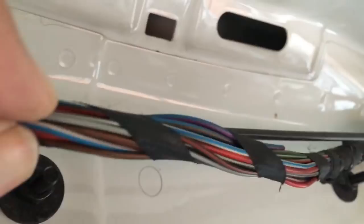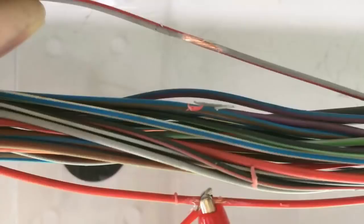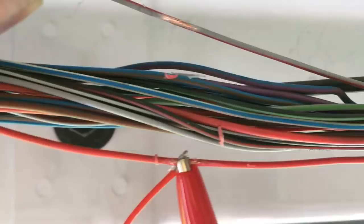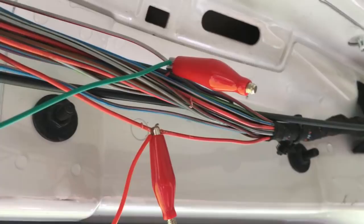I'm going to open up the cable bundle, pare off a little bit of the insulation, and test I've got the right cable. On that white-and-red cable I've just stripped back a little insulation so I can see the wire, and I'll get a temporary crocodile clip connection onto it to test the system. Once I've verified I'm on the right cable I can make a permanent soldered connection with heat shrink. This is only temporary — I've got the red giving me power supply and the green connected to the reversing light wire.